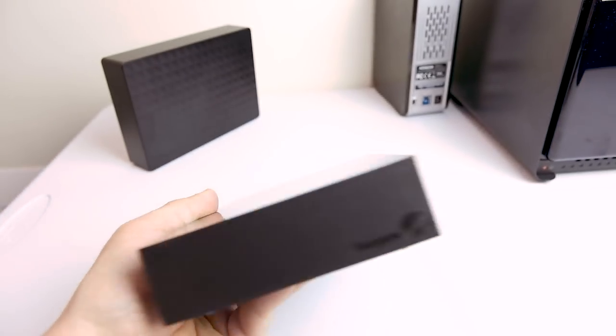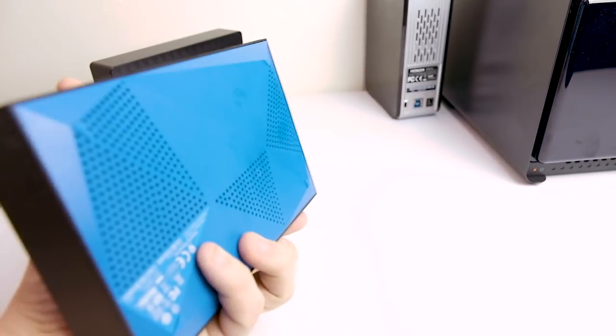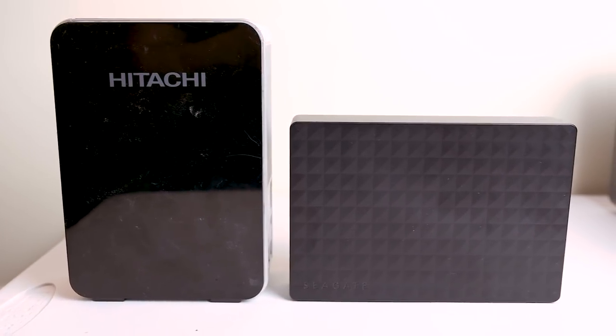So you need to back up what's on the Drobo or the hard drive. I'm using a Seagate drive at the moment to back up onto one single drive, and then I've got other stuff stored on separate hard drives. So I've got an archive of my work over the years and everything is also sat on the Drobo. I'm backing up the computer to an 8TB hard drive as well using something like Time Machine. If you're on a PC you can use something like Acronis, but it is a necessary step to back up your external drive or your main storage drive, whether that's internal or external.